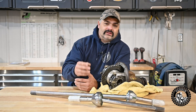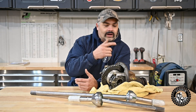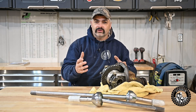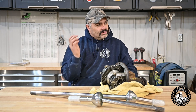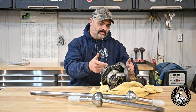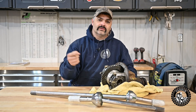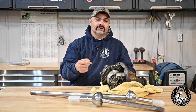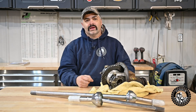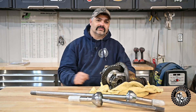I'm not going to go into big detail — Low Range has a really good detailed video about all of that stuff. I might touch on a few things you should know or look out for, but we're just going to do a simple rip-apart of the diff, put this 4.30 gear set with a Spartan locker in the front, put the Chromoly axles in, new seals, new bearings, stab her back together, and hopefully get out on a wheeling trip tomorrow.